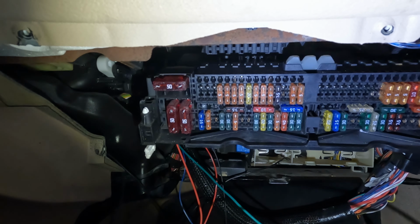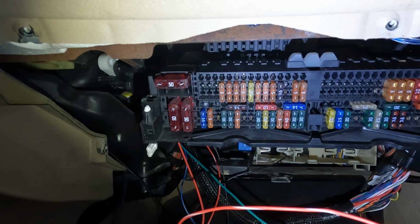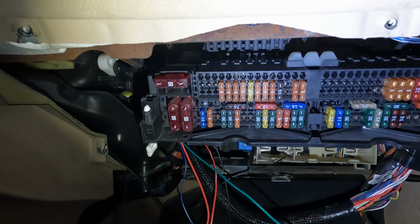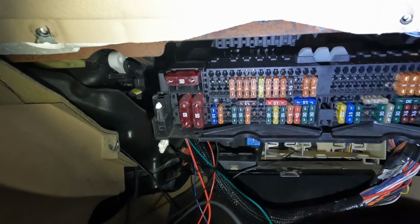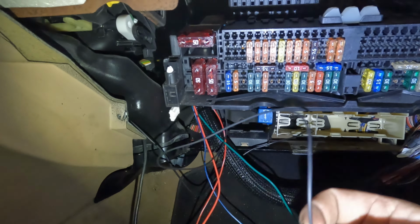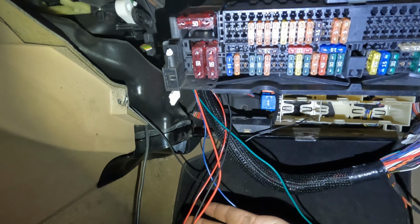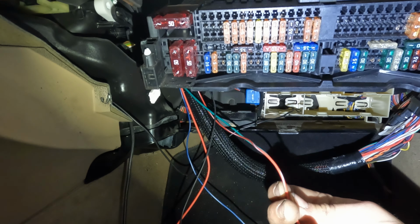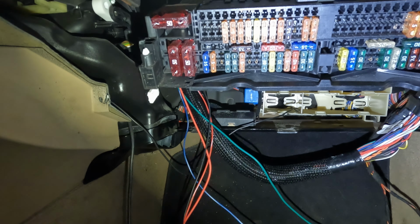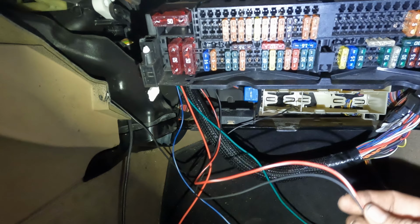Theoretically, your computer will turn on and you can turn the engine over with those 2. Well, also you'll need this ground. That's one of the other wires. There's a black wire. So I'll just start from the beginning here, just to make sure everybody's on the same page. Red and white, that's your switched power. Black is your ground for your harness.